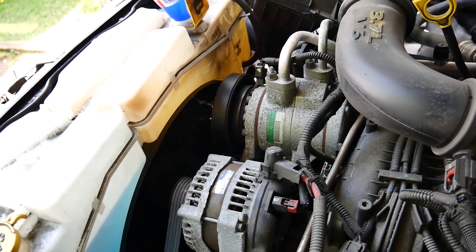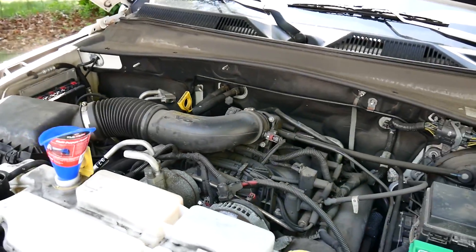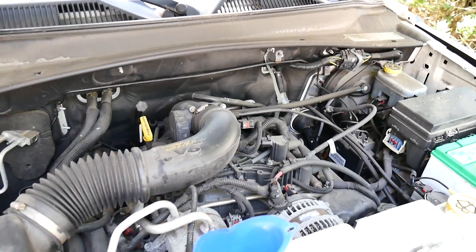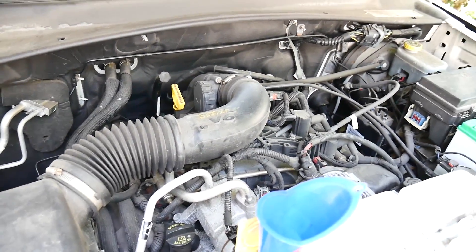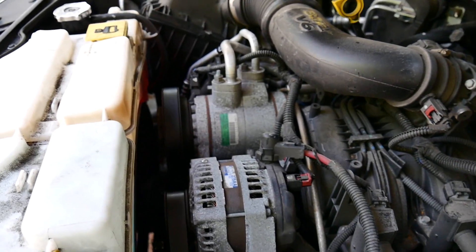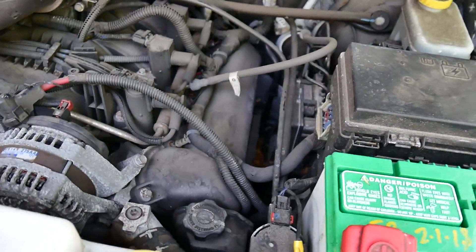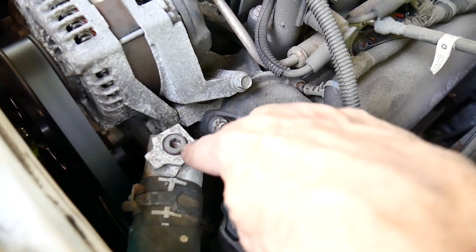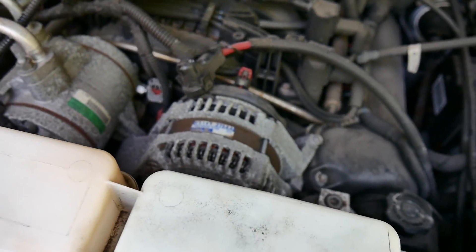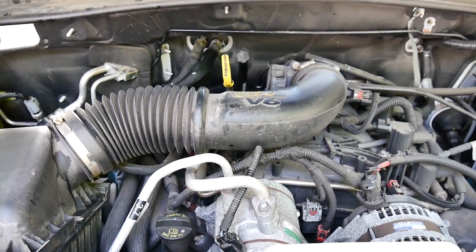Everything looks good so far — we're going to need to get more coolant in here. I'm going to let it run and get up to temperature with the thermostat wide open and the heat blowing, to make sure everything is circulating and opened up. After quite a bit of troubleshooting trying to get the air out of the system, we finally got it buttoned up. It's running good and we got the heat working. I had to put some coolant into this little bleeder screw there. Even when I did that it was still vapor locked, so I just let it run and heat up with the radiator cap off, then put more coolant in over there, and after messing with it for quite some time I finally got it to open up.